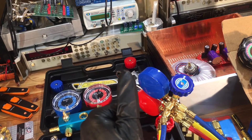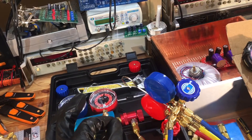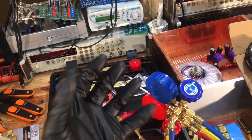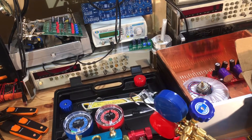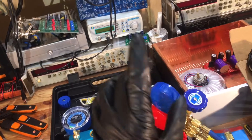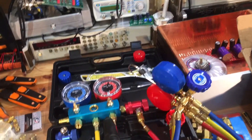Many years old, brittle actuators, diaphragms, vacuum hoses — everything that could go wrong. You only want to take it apart once because the customer will complain of rattles if you take it apart multiple times, or even once sometimes. When you put it back together on old, hard, dry brittle plastic, rubber gaskets and seals, and that foam padding between the dash and metal parts, it no longer works. If you disturb it, you own it, and the customer will come back.